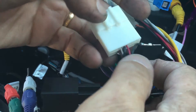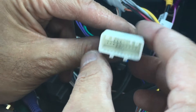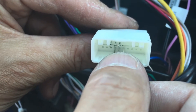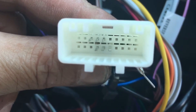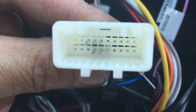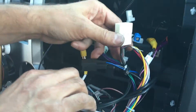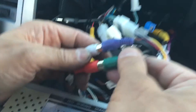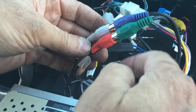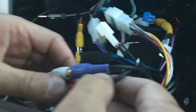The three Molex connectors that came with the radio are the top ones, and the three I added are on the bottom, in the same order. The middle one is ground, the left is for left input, and the right is for right input. The other end of this wire is the RCA connector — I connect it to the auxiliary left and auxiliary right inputs right here. If you connect those two wires wrong, you can just swap them.